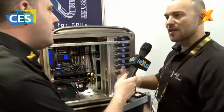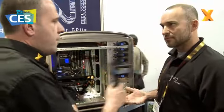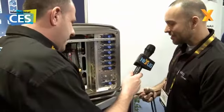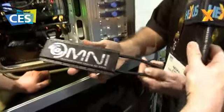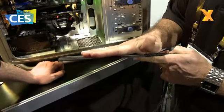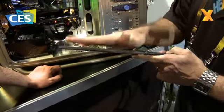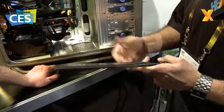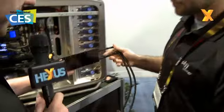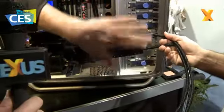What's new with that is that in the past, every time a new graphics card would come out, we'd have to do a ground-up solution — retool the whole cooler for the channels, fitting it over the die, covering the memory, and running fluid through that. So what's actually cooling it is the Omni ALC. The Omni ALC is a universal cooling plate — extremely low profile, allowing liquid cooling for the entire card, not just the GPUs. What gets it down onto each individual card is something we call an interposer plate, which is individual for each card architecture so that you can adapt to the different topography of the components.